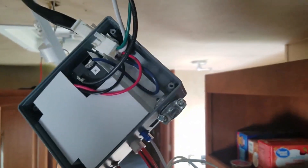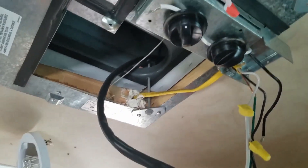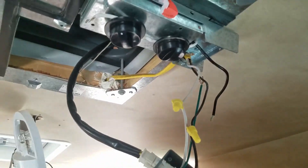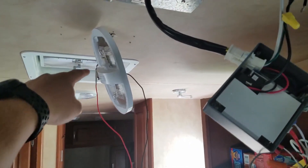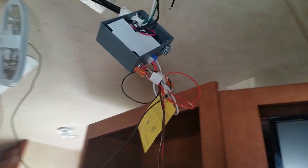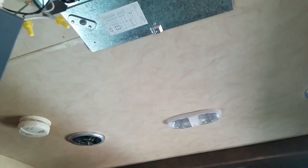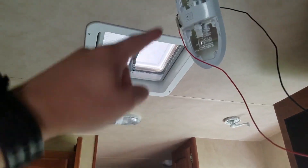On the 12-volt side, this is where things are going to be different depending on your installation. You'll likely already have a 12-volt positive and 12-volt negative source coming in somewhere into this box. In my case I do not, because this unit was just separate for AC, so you'll have to find a source of 12-volt constant power. I have a 12-volt light right here, but this one is controlled by a wall switch so it won't work — though for testing it works just fine.